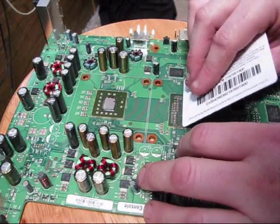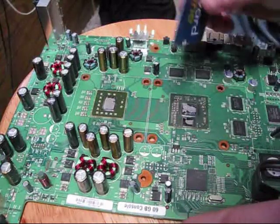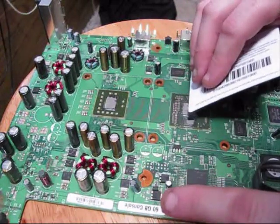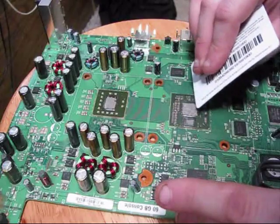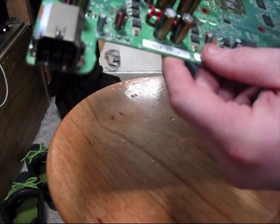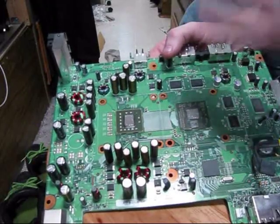You don't want it really thick. Use the edge of the card. I'm going to take this part off, because otherwise it'll get everywhere else. There are no wires coming out — no gold traces coming out of the chips. So you don't have to worry about shorting it out. I'm just going to get this as even as possible. There's no electrical connections — as long as you don't hit the resistors, the resistor pins, you should be okay. This grease also says that it's non-electrically conductive, so that's a good sign as well.